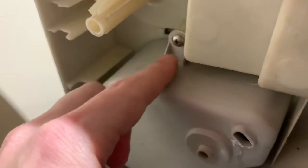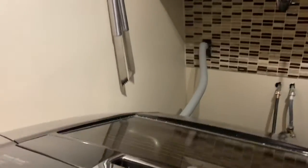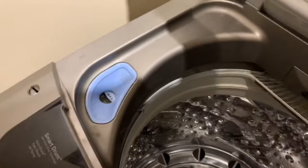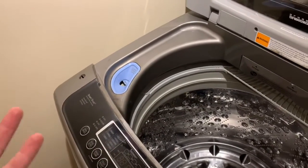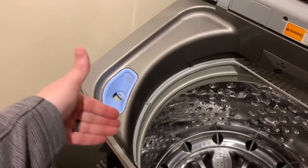The repair was basically just cleaning out that orifice. What I did was remove the whole tray — three Phillips screws — and passed a screwdriver through the hole to clean all the gunk out. But you don't even have to go that far. All you need to do is pour some boiling hot water with some vinegar through the dispenser to flush it out. That's probably the easiest way without removing the whole cover. Taking everything apart and getting in there to really clean it out helps more, but pouring hot water and vinegar is the first thing you could try, and if that fails you can go to more extensive measures.